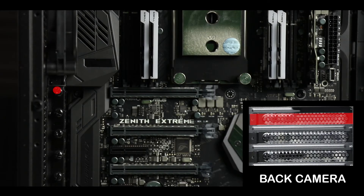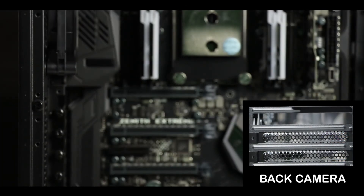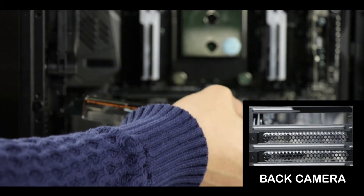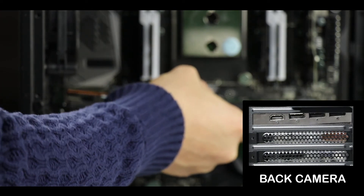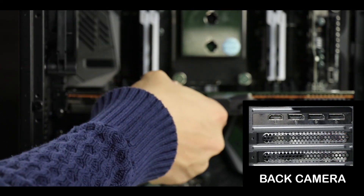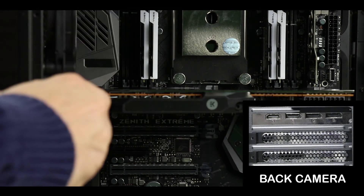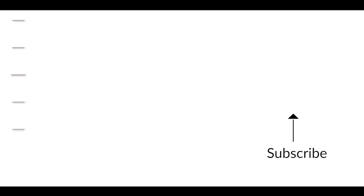The video card installation into the system is very easy. We remove the first-position shield and simply place the card onto the first available PCIe slot. If you are careful, very little should go wrong at this stage. Make sure to hear the little click from the locking mechanism of the PCIe slot, then put back the screw to secure the whole thing together. Next step: tubing the water cooling system.